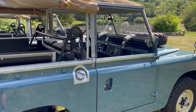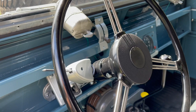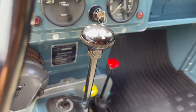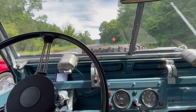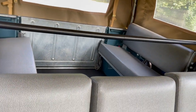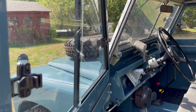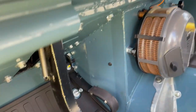The interior of the vehicle is also very important to us. We shoot for originality with slight improvements — like using late Series 2A fuel and temperature gauges with a semiconductor voltage stabilizer, which works better than the original gauges in reliability and accuracy. We rebuild the original speedometer to the vehicle; in this case it was returned to zero and now has roughly 300 test drive miles on it. For the interior we keep the original vinyl seat upholstery called elephant hide, which is iconic, and the iconic banjo steering wheel is very important to us. The interior paint finishes are done to the same standards as the outside.